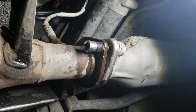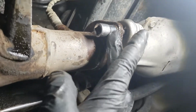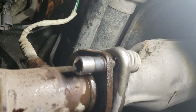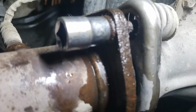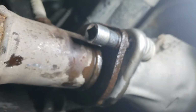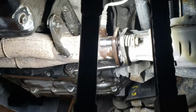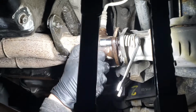All right, so I'm still having a problem on this bolt right here. It's so rusted, so much corrosion, that it looks like the bolt is round. So my next option was a 7/16 socket. I kind of just jammed it in there and used a hammer. It's pretty tight. I used the hammer, put my ratchet on, and then she started turning. So that's good progress. After that, I'm gonna do the other side. All right, 14 mil at the back, and then just start wrenching.